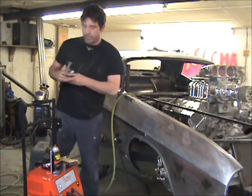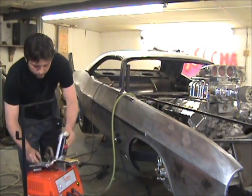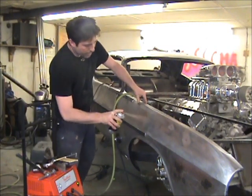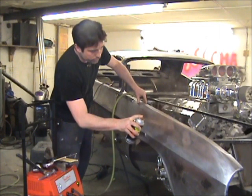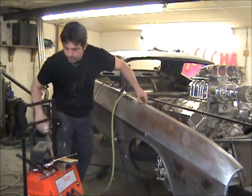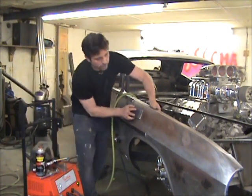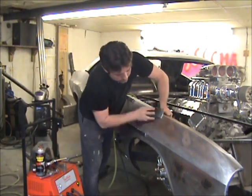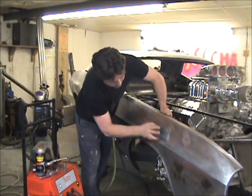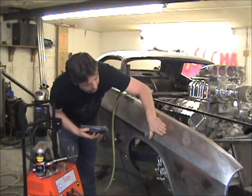So once you've done your initial shrinking, you can come back and check yourself with this guide coat trick. Even with the highs, I can highlight and show you guys how big the dent is or isn't. I'll just use the sanding block. That's pretty good — if you've got a slight low there, not a ton.